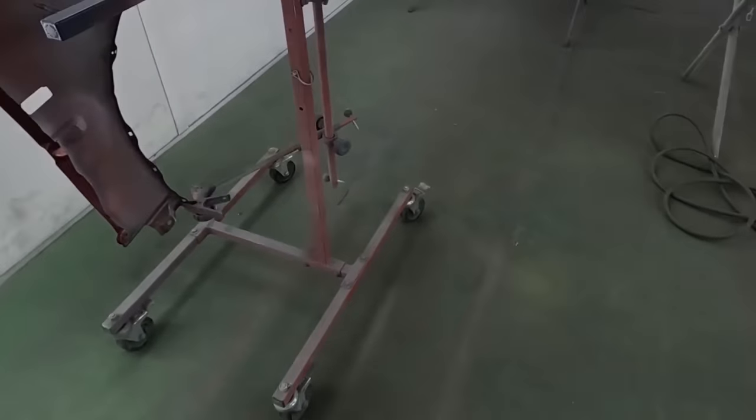Now over here, where we've cleared, we're gonna use a soft edge foam tape. You can use a foam tape, or you can even use a back mask tape, or even a tape that's folded on itself, just so it creates a soft edge right here at the corner of the fender. And this is what it should look like. So what I did is I put a piece of tape over it, because sometimes the foam tape can fall. So I put the foam tape right at the edge here, and then I put the masking tape right over that.